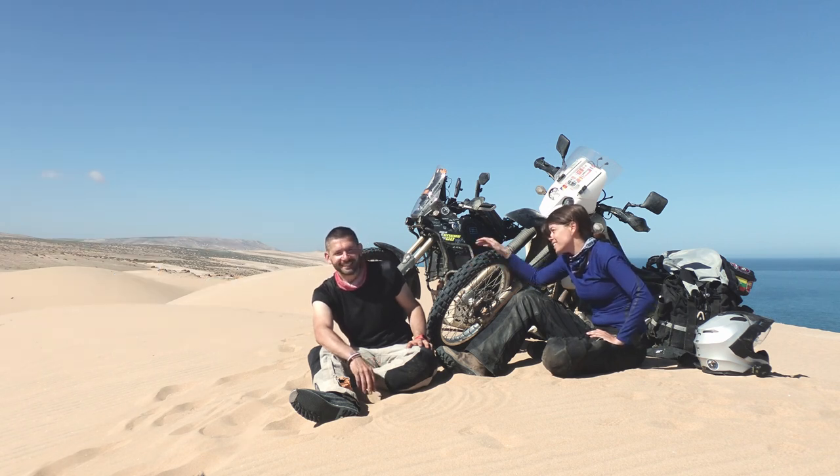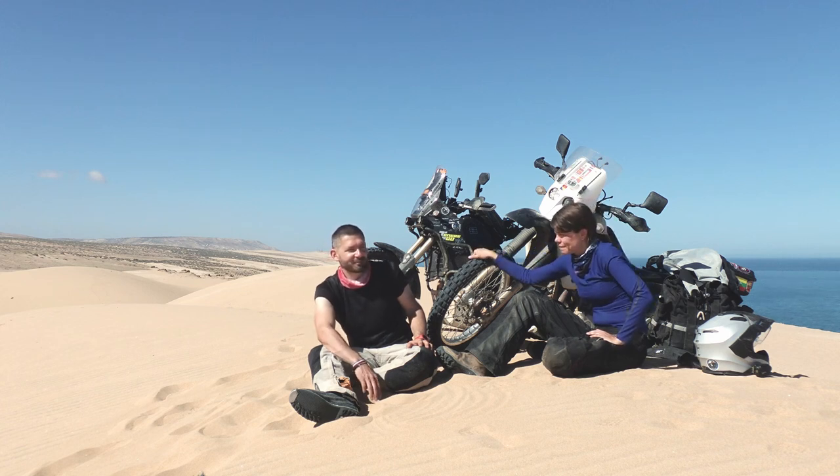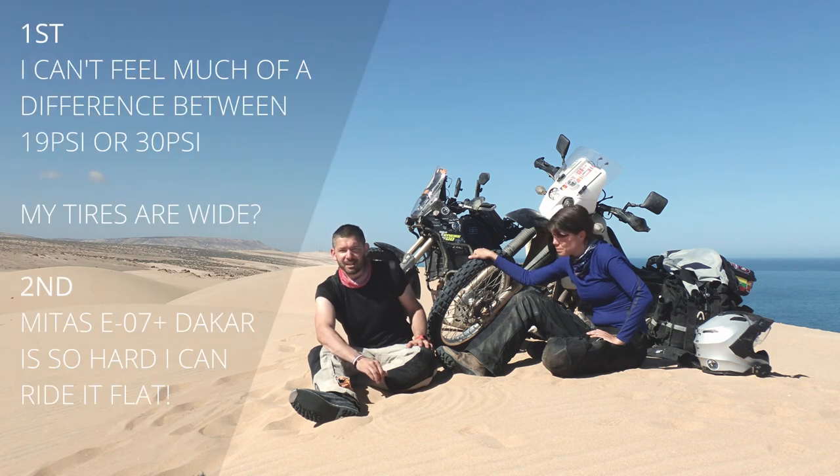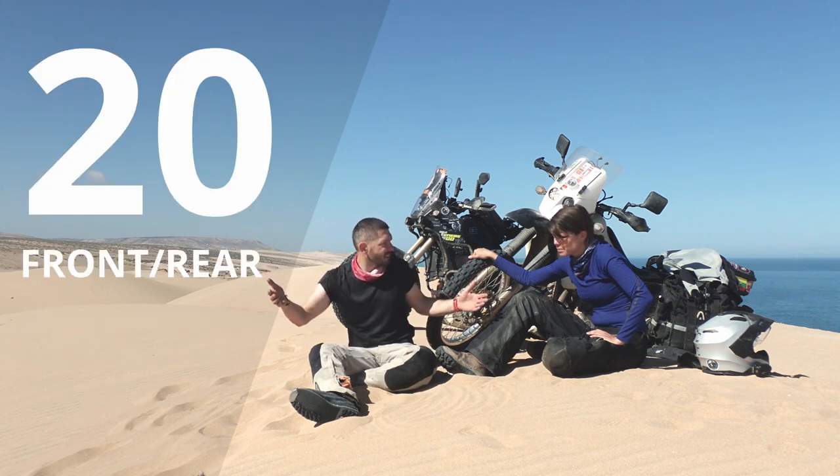What about you? You don't have those things? No, I don't have tubes, I don't have rim locks, and I have a big ADV bike — so the tire pressure gauge doesn't really help me. With my tubeless Outex kit I cannot go lower than 18 or 19 PSI. I probably could risk it but I don't want to. I'm basically running it on 20 and that's it.